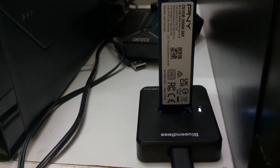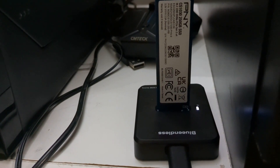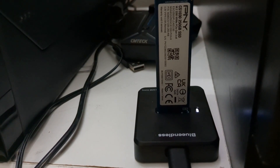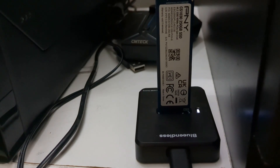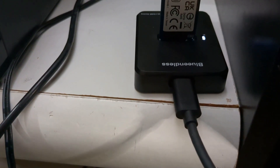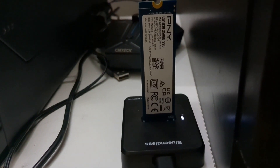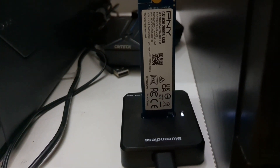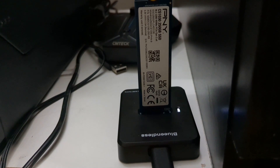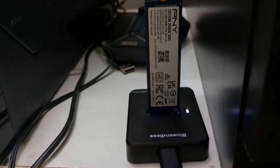The reason it's transferring so quickly is because I'm using an SSD in my computer as well. The SSD in my computer is not an NVMe SSD — it's a regular SATA SSD, and therefore is limited by the M.2 SATA standard, which has a maximum transfer speed of less than 500 megabytes per second. However, if you're using both NVMe drives you'll just be limited by the cable connection, which is officially 945 megabytes per second. Remember everything has a bottleneck — sometimes it's the CPU, the cable, the adapter, or the SSD. In this case there were very few bottlenecks, so I was able to transfer at 350 megabytes per second.